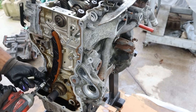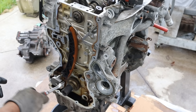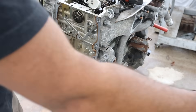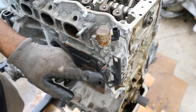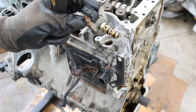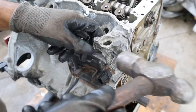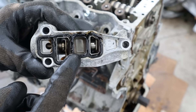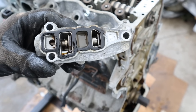A 5mm hex was holding this on — I ended up getting it by hammering a T45 onto it. This slide is looking in decent shape as well. This is the VTEC switch — it sends oil pressure to the rocker arms — and here's an oil pressure sensor and the oil pressure switch, which looks like a VVT solenoid but a little bit smaller. In a lot of Hondas, if you've got a little bit of an oiling issue, a lot of junk is going to end up in this screen and that's going to affect your VTEC performance and make your engine run like a pig.